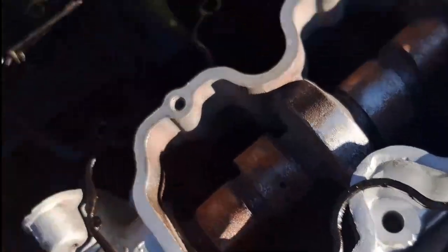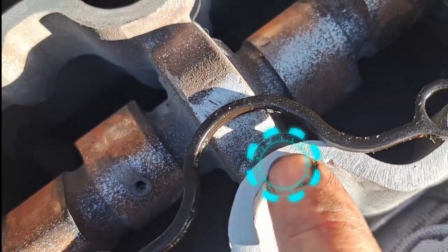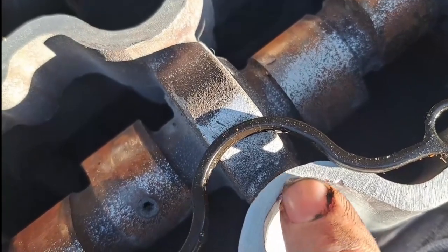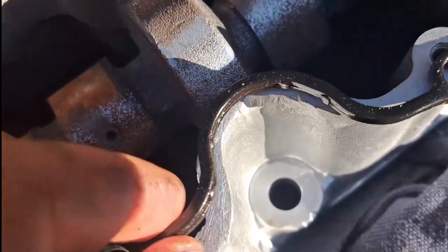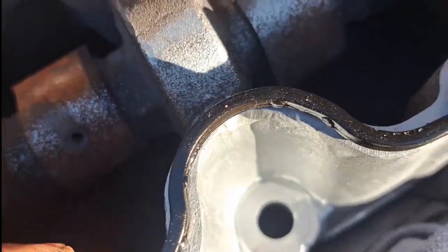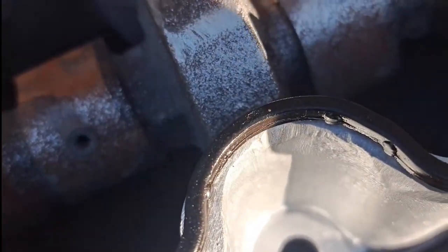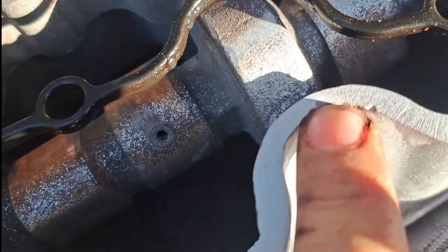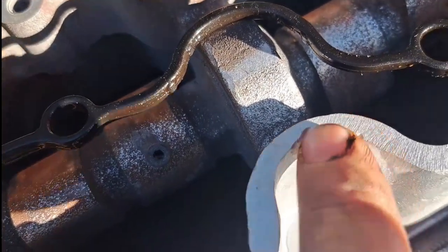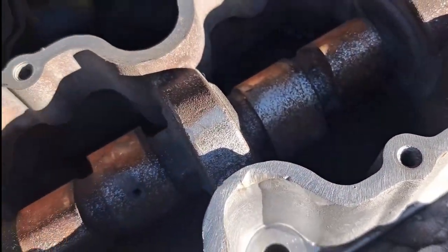This is the seal that goes inside the cover — look how thin it is there. There's just that space to play with. It seems like it fell or cracked and chipped when cleaned. I'm not sure what happened but it didn't look like that before. If I put the seal on it might just catch on that area and seal it. I think what I'm going to do is take a little bit of Pratley steel and fill up that gap to give it a flatter surface, just to make sure it doesn't leak down there — otherwise this whole exercise was for nothing.